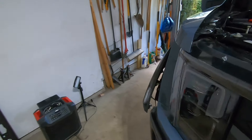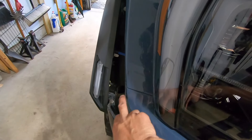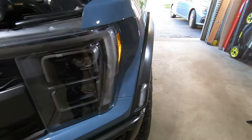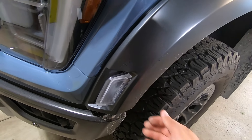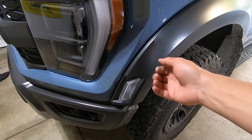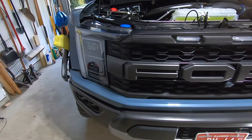I'll show you what we're looking at on the other side — I already went ahead and popped it off, so these are the clips that you're going to pop off. You just need enough clearance to get this little trim panel free. Throw some gloves on, reach right on this corner, and that's going to pop off. It's going to make a kind of ugly noise but nothing really breaks, just give it a quick jerk and it'll pop right off. Once the fender flare has popped off on both sides, go ahead and pull off this trim piece.